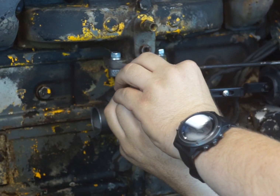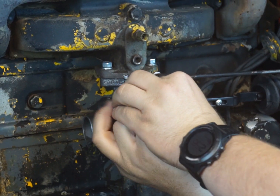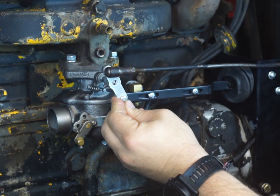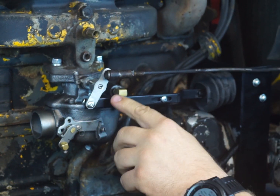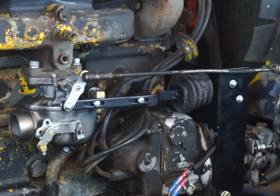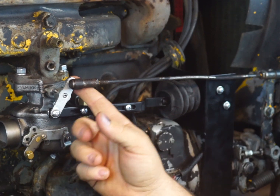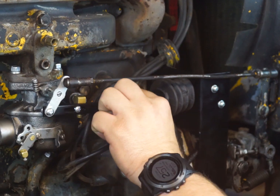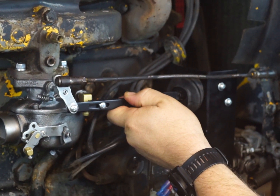You want to have them tight, but this one you don't want all the way tightened down — just tight enough to where it holds things together and will still slide freely. You're probably wondering what these slots are in this linkage arm — those are your adjustments for the low idle. You've adjusted this arm for the high idle on your carburetor, but now we need to adjust it for your low idle. Pull that all the way in.